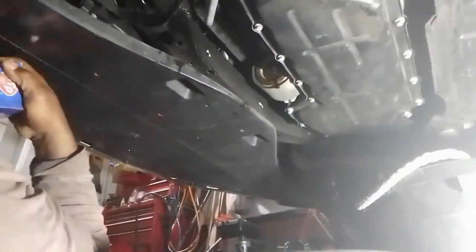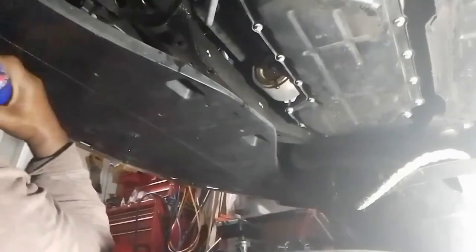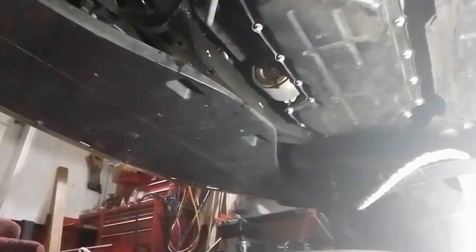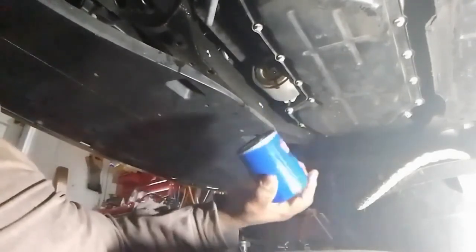This car comes with a plastic dust cover, so you've got to reinstall that — it goes up under here. Now let's get this oil filter back on. I usually like to fill these things up with oil, but because this one is sideways, all I can do is put a little in there and wet the oil filter up, which is better than nothing.